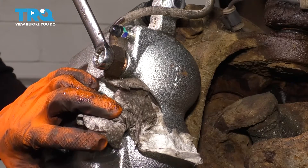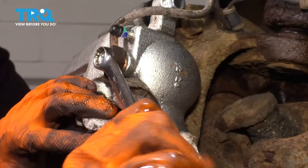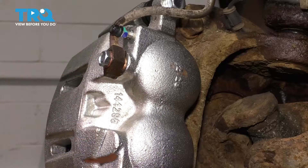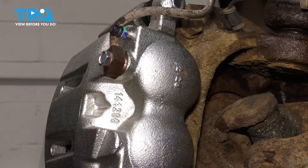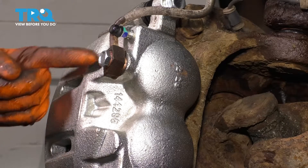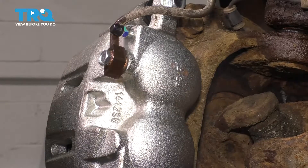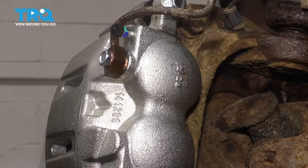That's bottomed out. Now give it about a half turn — basically you're crushing these copper washers together against the hose, bolt, and caliper, and that's what creates your seal. If they are not crushed tightly — though obviously don't over-tighten it — it will leak as you step on the brake pedal. Now let's clean up the mess because you don't want to confuse any residual fluid from the hose transfer for a brake fluid leak.